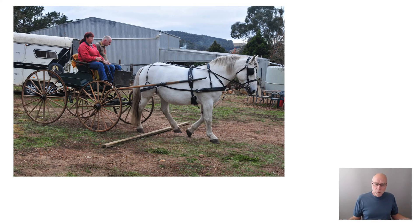Over bumps, here we can see Peggy taking us over a piece of timber lying across the ground. When we went over it at walking pace, yes, you could feel it, but only marginally. On a rougher surface at a trot — 15 to 20 kilometres an hour — the ride was really outstanding. There were no sudden accelerations, no sudden jerks, no pitch or roll accelerations, no vertical accelerations that were objectionable. I was amazed at how good a ride quality could be achieved without pneumatic tyres. Over that bump, you could tell you'd gone over it, but there was no objectionable feeling — nothing like a bang.